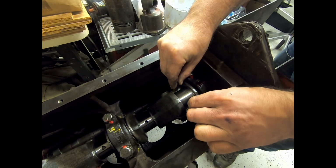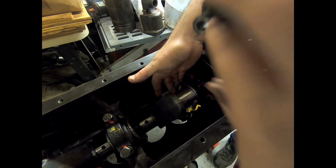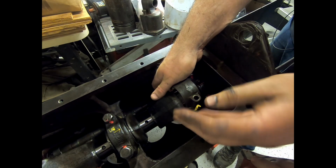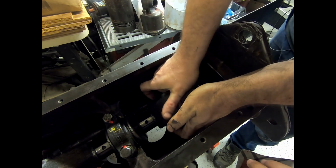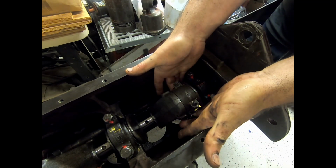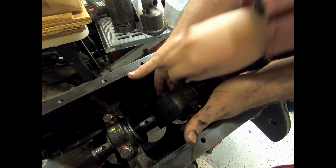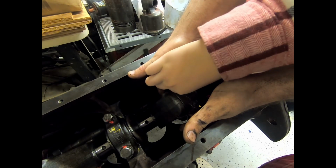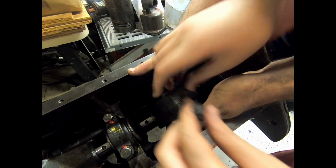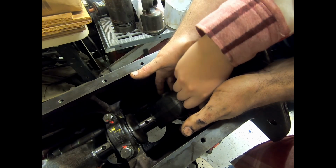All right. Now grab the cap. Yes. Wait. Make sure it's going the right way. There we go. Okay, grab the nuts. Do you put the green stuff on there? Yeah. We don't want to twist or move it around at this point. We want to just pull it up tight, okay? You got that set to 35 foot-pounds? Yes. Good deal.